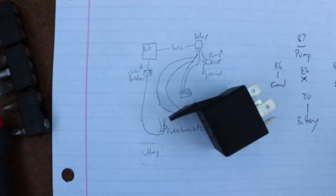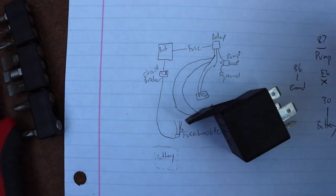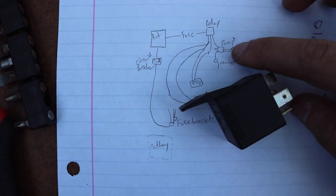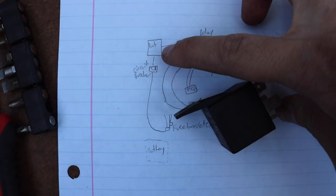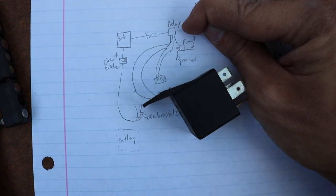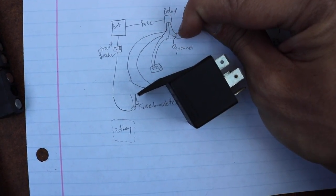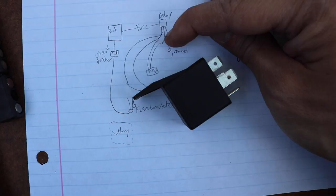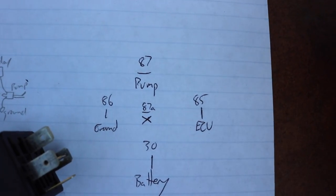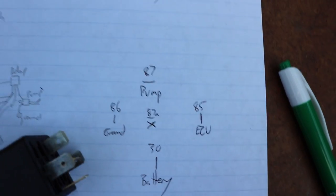Part of the confusing thing about figuring this out was trying to figure out which wires go where on the relay. I've mapped it out in a rough diagram so I don't screw it up in the process. The fuel pump is here — we're intercepting the wiring that goes from the fuel pump to the ECU to run it straight into the battery. The battery is connected to the relay, the relay gets power from the battery and supplies it to the fuel pump, but it only turns on once it gets a signal from the ECU. We'll also have it grounded off somewhere. For the relay itself, you need four of the five pins — we don't need pin 87A.